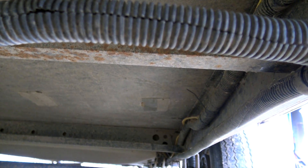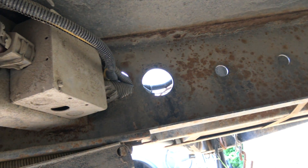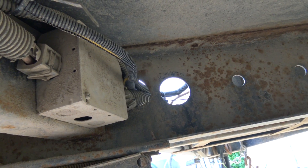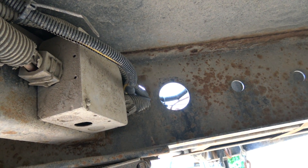I tucked all the cable along the inside of the travel trailer chassis and just went up through a normal opening. Where I had to go through any hard holes in the frame I used half inch flexible conduit just to protect the cable. You could also do the same for the whole cable if you wished — I didn't feel it was necessary.